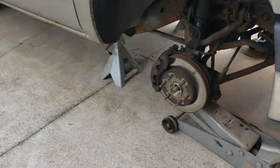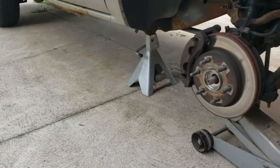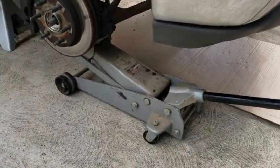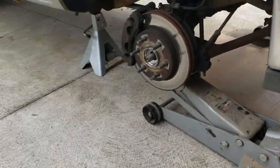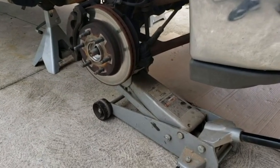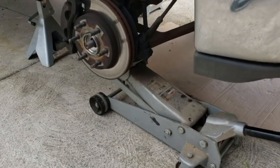So far what I've done is I've got the vehicle up on some jack stands. The jack stands are on the frame, and then for additional safety — because I just do not like crawling around under vehicles — I've got two 3-ton floor jacks, one on each side under the front wishbone, just in case a jack stand slips. Double up on the safety, and now let's get down underneath this thing and take a look.